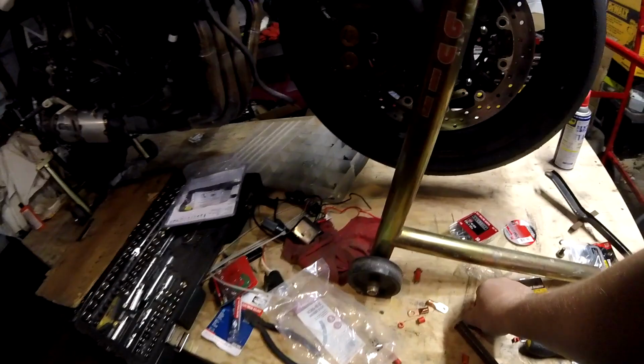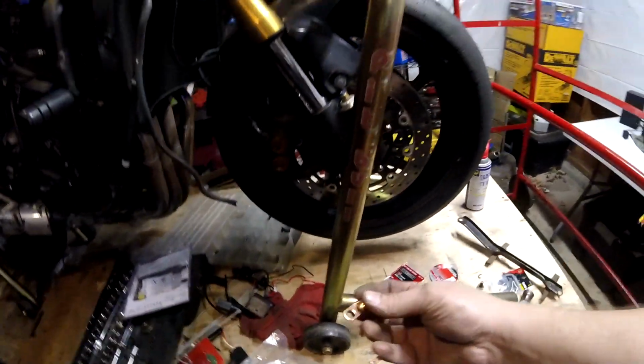So I'm going to go ahead and crawl back under the truck one more time. I probably don't need to put this on film. It's not a big deal. I'm going to find a place on the frame that's easy to run a bolt through, like a pre-drilled hole. And I'm just going to scrape all the paint off of it with the Dremel or a sander or something, whatever fits up in there best. And I'm going to get the paint off the frame, get the rust off the frame, get a nice shiny spot of steel, and then I'm going to bolt one of these lugs right to that shiny spot of steel with a bolt going through it, okay?